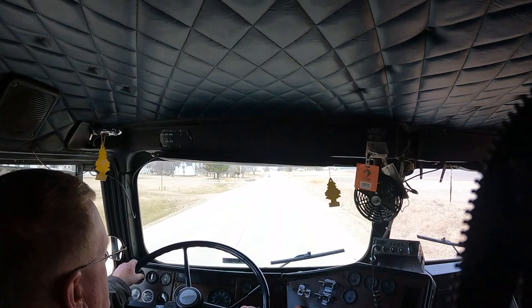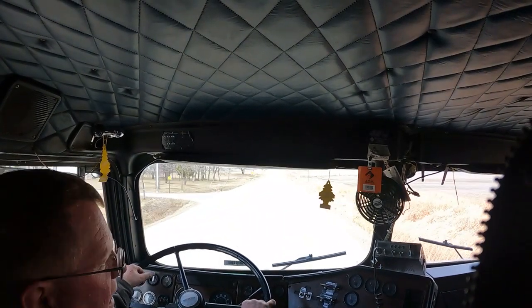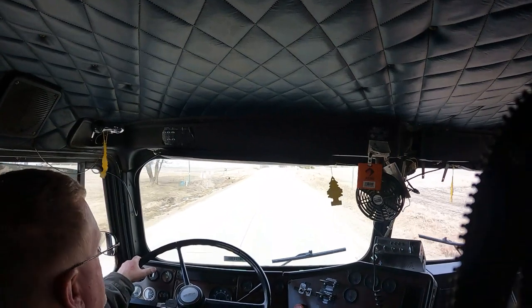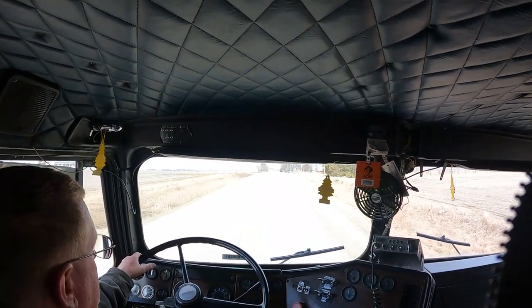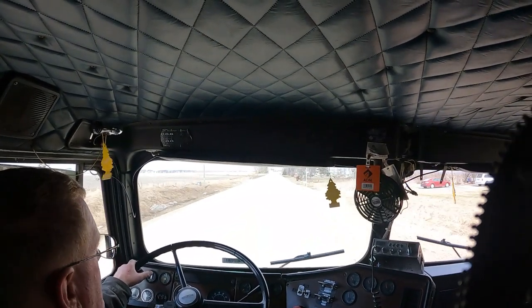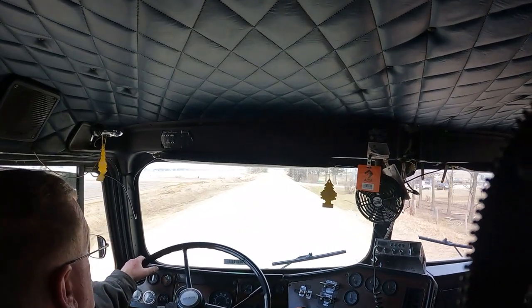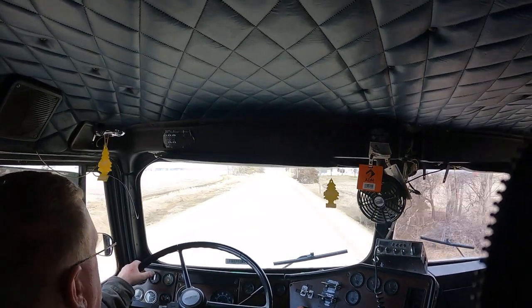Had another deal. I just thought the lights were dim. Always have, I never thought the lights were really good on the truck. And I discovered the high beams, put them on high beams, after a little bit they'll kick out. Well, all right, got stupid on that. Breaker, put it on high beams, and after I don't know a minute or so, you cannot have your finger on that breaker. It would get hot, and the relay kick out.